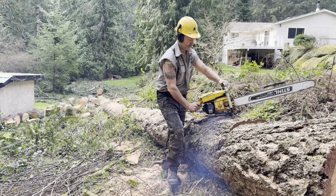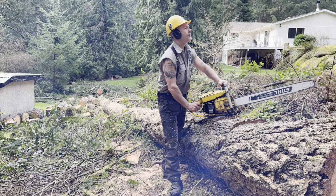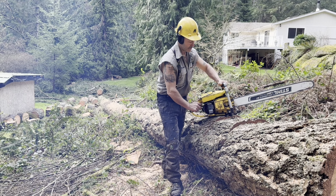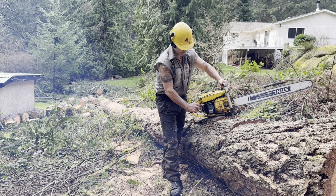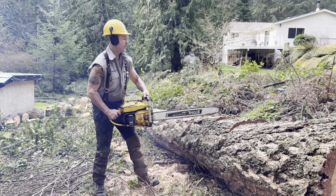So it's still cutting nice, and I'm going to share it with you, but to be honest with you, friends, it wasn't getting oil. The chain was tightening up on me. The first buck is okay, but then on the second one it started to tighten up, and I was pumping oil like crazy to it, and it was all dropping out the bottom. Do you get what I'm saying? It was dropping out the bottom by the clutch. So enjoy, friends.